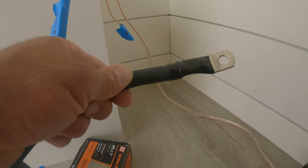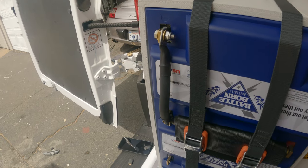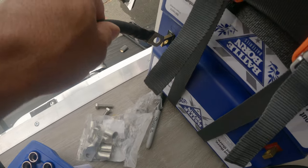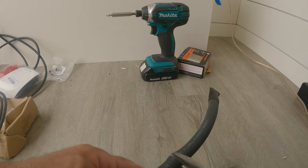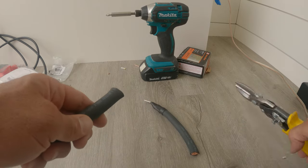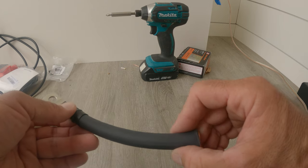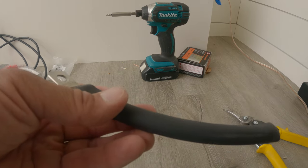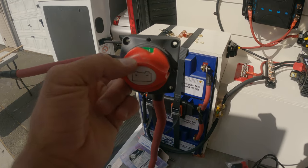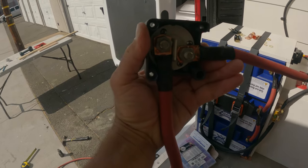You should have a nice clean connection here. I've already got the first negative one on. This one's gonna go from here to here, and then you can just cut these wires with a pair of snips. So now I've got this at seven and a half inches — I'll take off a little bit, put another lug on it and it should connect right there. So I'm wiring in this main shutoff switch to allow me to turn off the battery if I ever need to work on anything — it's pretty simple to wire in, just like that.